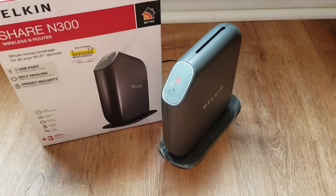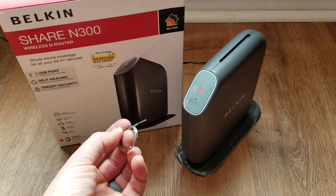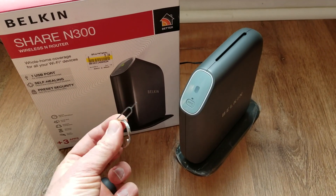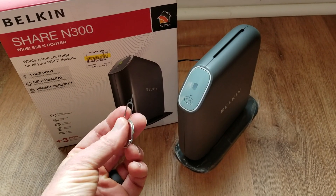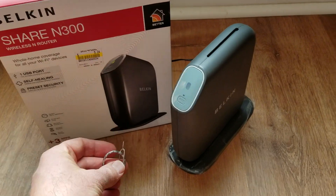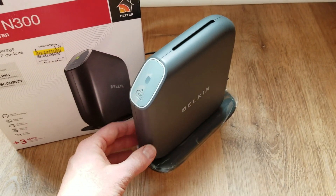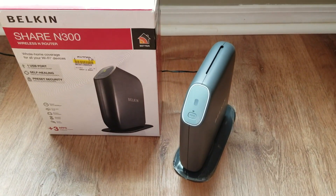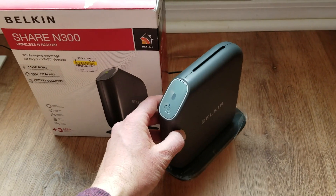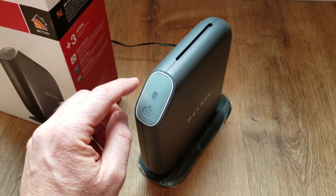To accomplish this reset, you're going to need just a couple of things. Number one, you're going to need some sort of a pin or a fine point in order to hit the reset button. I'm using the cell phone SIM card key, which you can find in the description box below. These are great to have around for these kinds of things. You're also going to need the default password and router settings for your specific router. That can be found usually on the bottom of this router, and as long as you have those, you can reset it and be able to access it again.